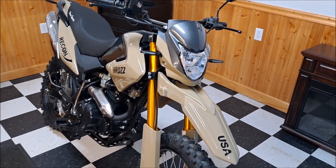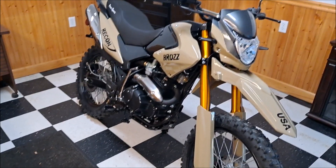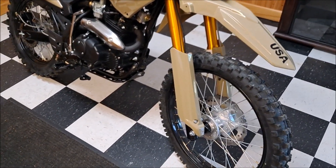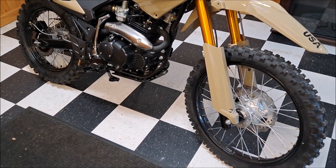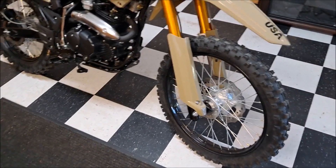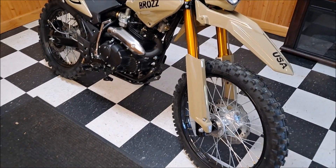It hit me that it feels more like a sport bike, or really like an adventure bike. The tires — obviously I'm sure they're great for riding on soft surfaces. However, for the riding that I do, which is a little bit on pavement but a lot of it is hard pack gravelly roads, state truck trails, kind of things like that — on hard surfaces these tires are not good, not good for my purpose. So I'm probably going to be looking at getting a more 50/50 type tire for this bike, which I'm sure will smooth things out dramatically.